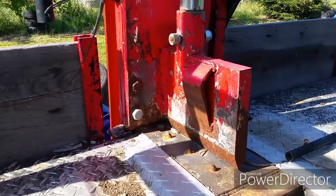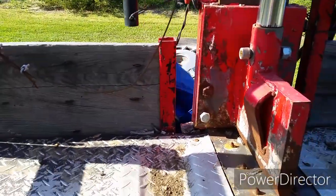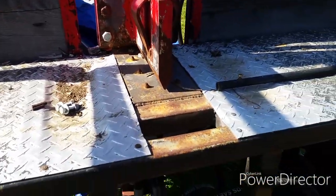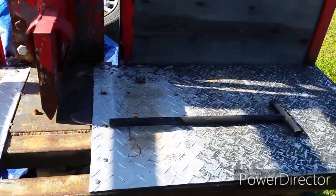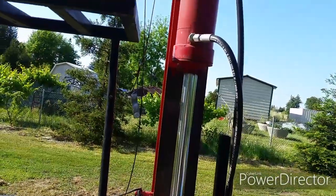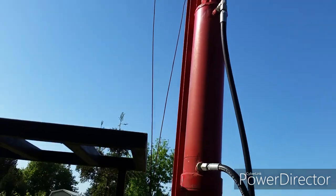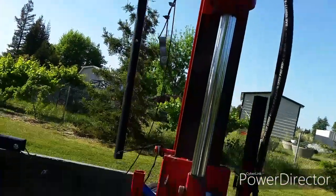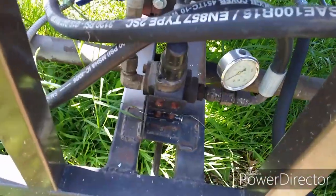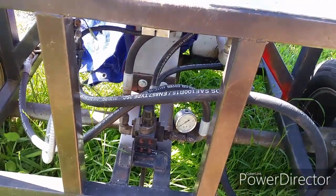So I just want to show you this massive log splitter that I built a few years ago. It's an upright log splitter. I have a platform on each side. It also has a cable driven hydraulic lift, so you can lift large rounds onto the countertop. And I want to be hands-free. I've installed the control right by my foot area with a lever, so I can control it using my foot.